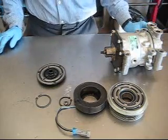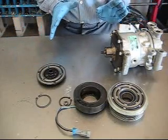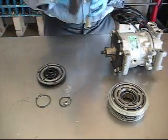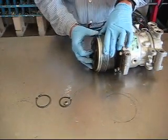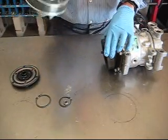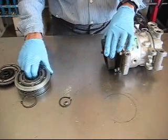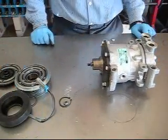You can refer to our video on replacing the GM clutches for a more detailed explanation on getting the clutch off. You will need to remove the three pieces of the clutch: the front hub plate which is splined and should pull right off, a two or three jaw puller to pull off the pulley and the coil — which leaves us with the compressor.